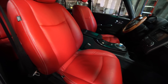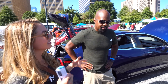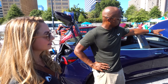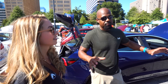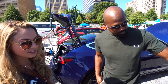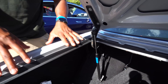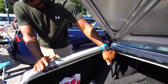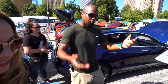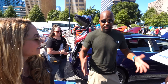It's mind-blowing that you're able to do that — you have to be a mechanic, a software engineer, and handle a little bit of electronics, high and low voltage. Bill, the gentleman with the dark blue shirt, is my partner — he's one of the best body modifiers and restorers I've ever met. These Mercedes came with a spring-type hinge to keep the hood up, and because this was retrofitted onto a different chassis, we didn't have that. So we had to make a shock system for the front and rear. It didn't seem like a big deal, but to get that to fit and open and close right — and to do it a hundred times — so when a client gets in, it's like nothing to them. It's like OEM. That was the challenge.